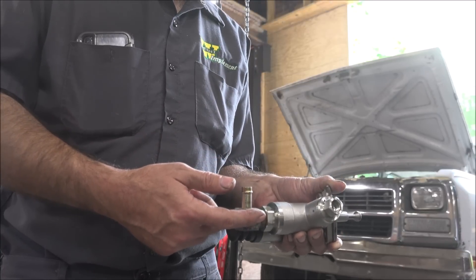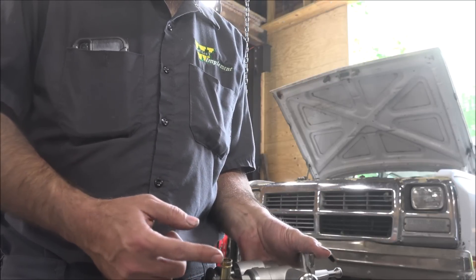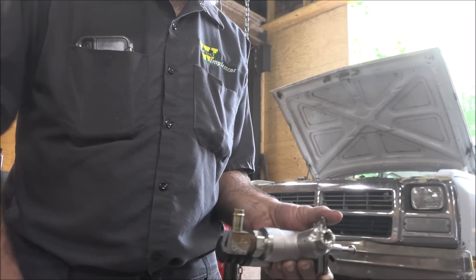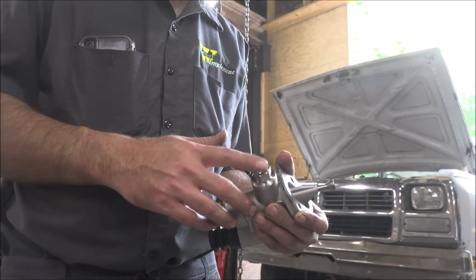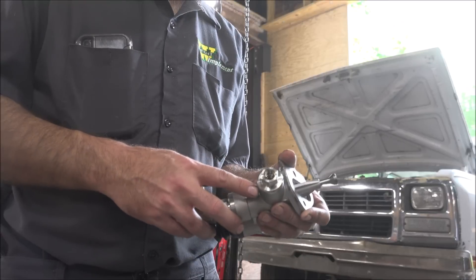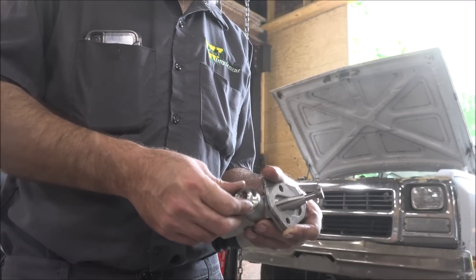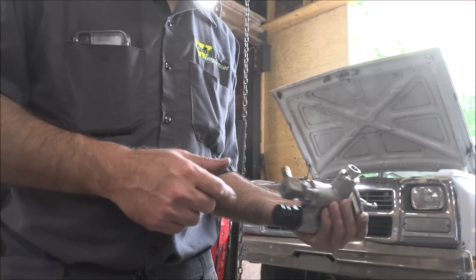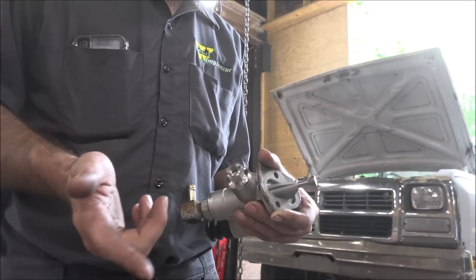This appears to be half inch pipe thread on the inlet. Of course this hose is way too big, so I'm going to have to get a reducer — put a reducer in here to go down to three eighths, which is what the line is on my truck. Might starve this thing, but it probably needs starved anyway because you're not supposed to use these on VE pumps — they'll make too much pressure. I can find no published values for what fuel pressure this is supposed to actually make, so I really don't know. It may be just fine, but I'm going to have to tee in a fuel pressure regulator to start it up and find out what kind of pressure it actually does make — and whether or not I can do away with the regulator or have to keep it.